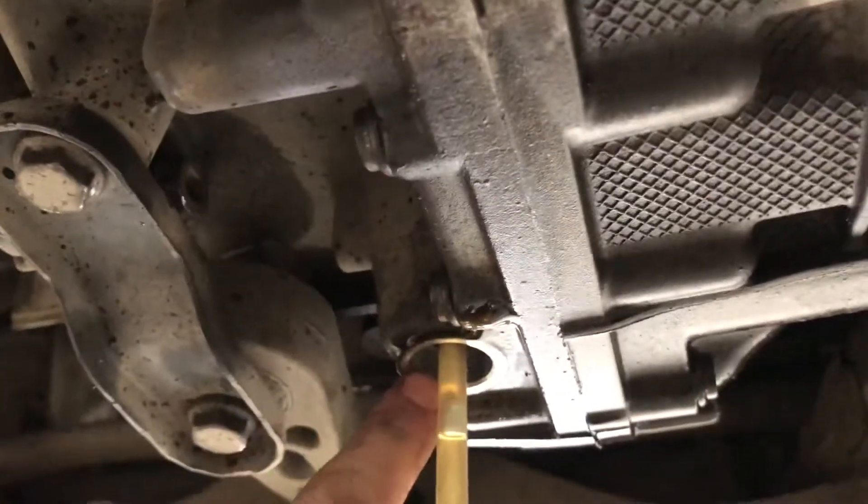What I noticed this morning when I started and was getting the temperature: it was at 11 degrees — it's April, about seven or eight degrees ambient air. I started it, left it idle for maybe three to five minutes, and at that point it was starting to get warm. They like it between 30 and 40 degrees. So if I was giving anyone a tip: start it, run it for three to five minutes, and if you don't have scan tools, then check to see — car running — pull this plug out, and as you'll see there's no oil coming out.